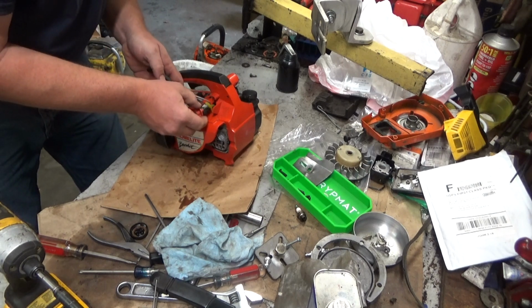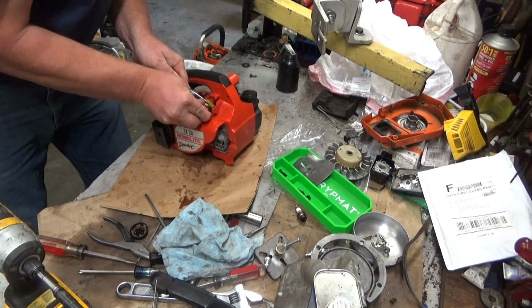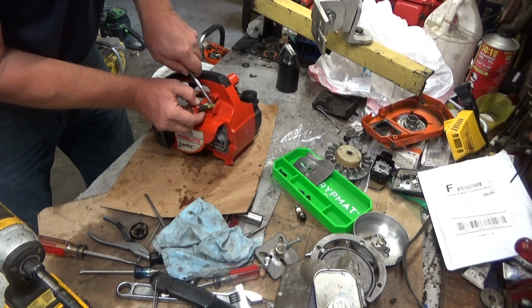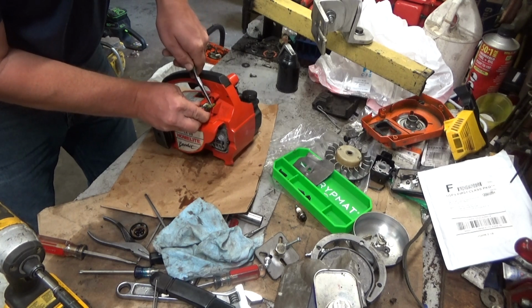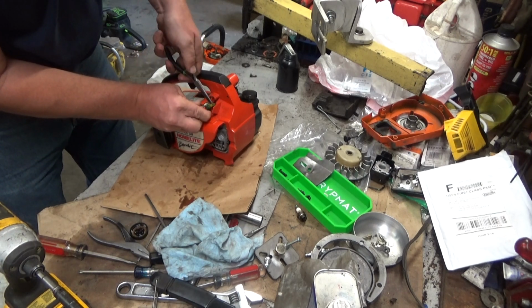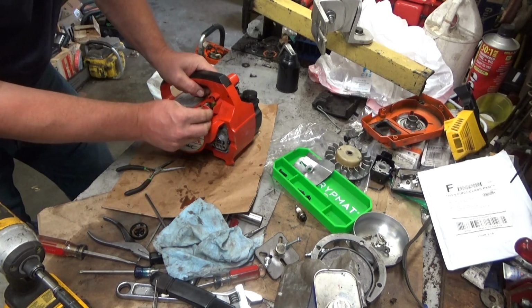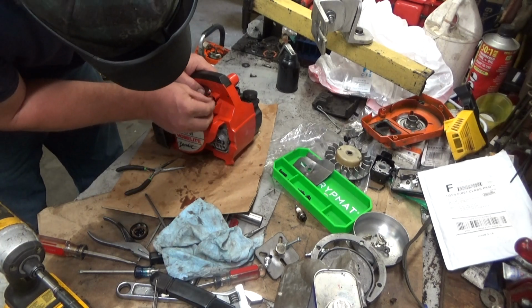Now I'm going to use needle nose to get that seated the rest of the way. The outlet is the outside one. And I probably still have more hose than I need on this outlet, but that's okay. I'd rather have a little extra to work with than not quite enough. On this oil pickup hose, I could always pull some out of the tank and then push it back in. So then, you're just going to push this in place.